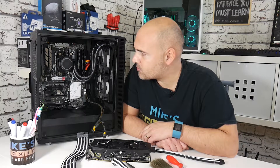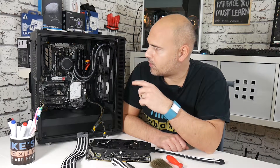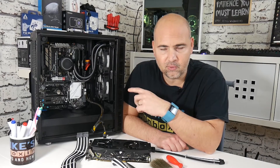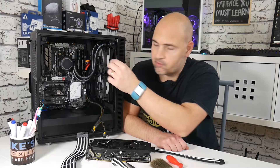That's pretty much what we plan to do. The best thing to do is actually start doing it. We're going to start with taking the back of the case off, disconnecting the power cables, reconnecting the extensions, passing them through the grommets, and then plugging it all back in.